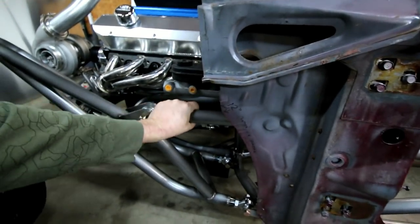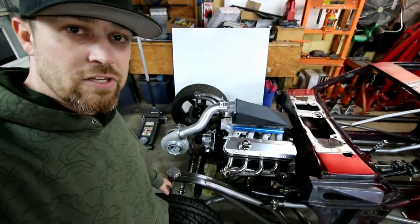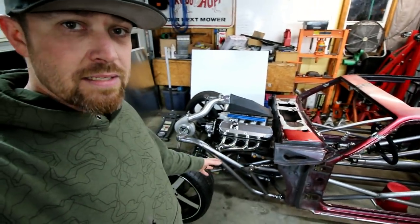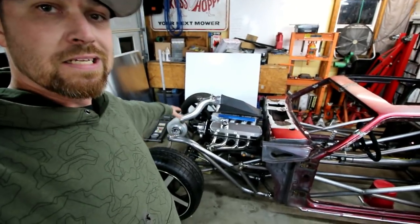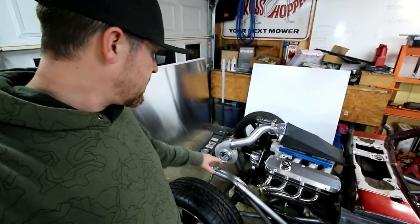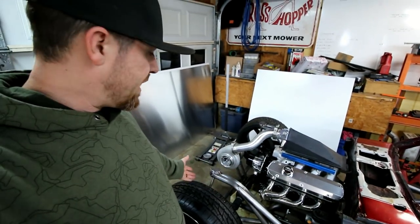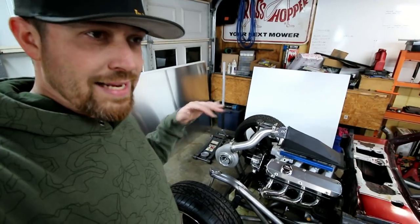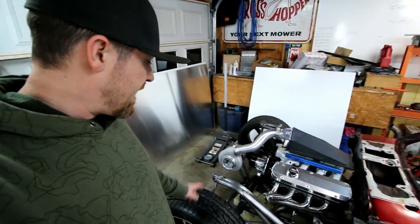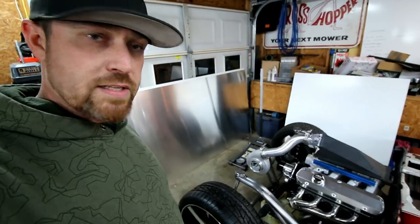With this section I'm also able to adjust the actual height. The plan as of right now is to continue to run this hydraulic cylinder with an accumulator, which will act as a spring. Basically what you see is how it will ride down the road — no springs, no shocks. The hydraulic cylinder and the accumulator will be both the spring and the shock in one. The only thing I'll probably change is putting a 10-inch hydraulic cylinder on the front versus the 8-inch I've got, because right now the 8-inch is fully extended. You've got to have some droop and some compression. With a 10-inch it'll be at the right height and have like two inches of droop if I need it.